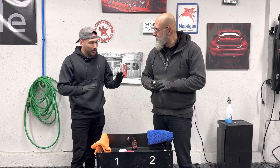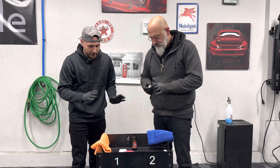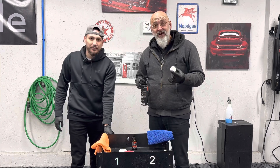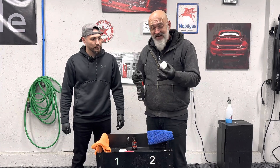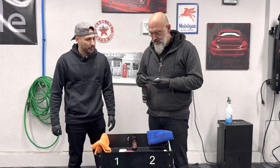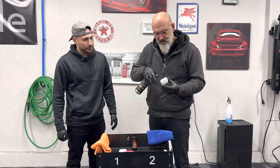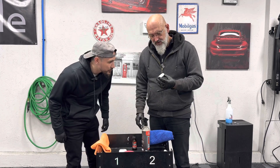Since we're using it on the old AirPods, the first thing we're going to do is iron decontamination. The reason we're using iron decon is that I keep these in my pocket a lot when I'm doing welding and grinding — they're magnetic, so they attract metal, and now I've got metal actually embedded into the plastic. We'll spray a little iron decon on here and see if this actually is iron or just dirt.